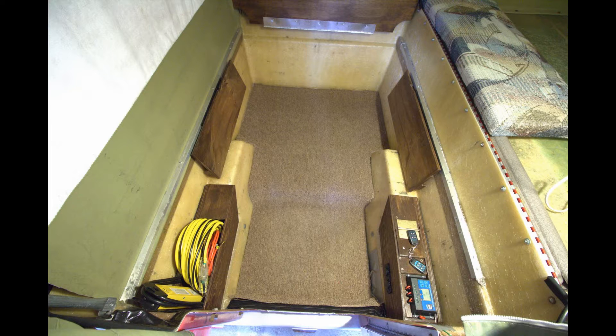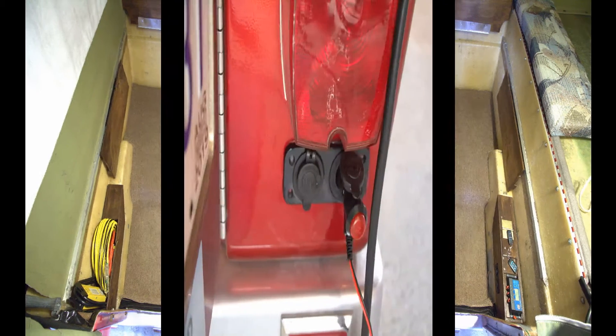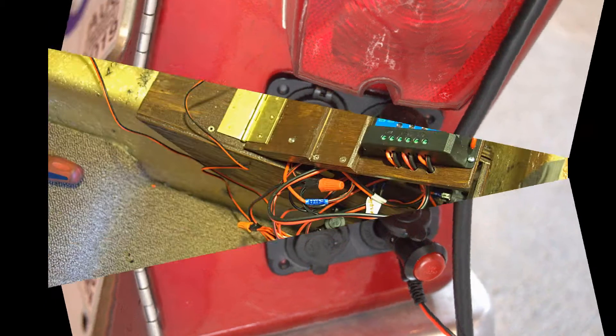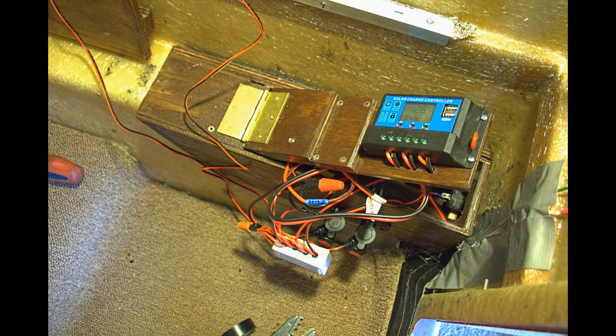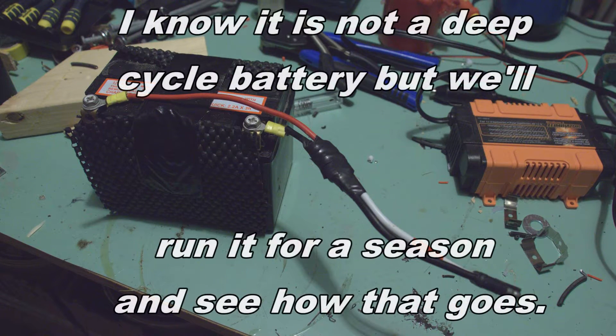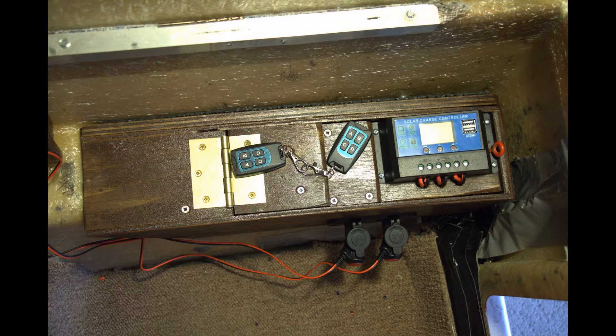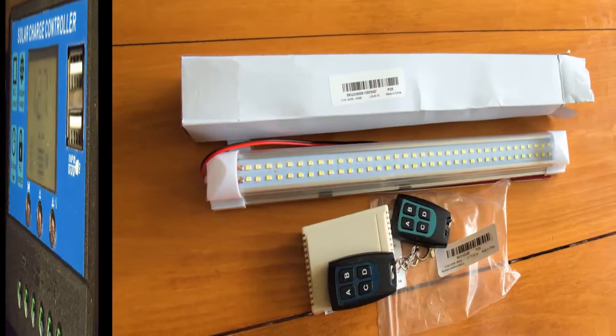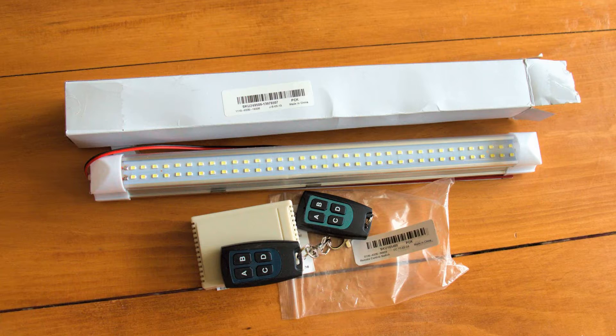I built some storage in the sides of the Minimate. I put two outlets on the outside opposite from that inlet — those are for my outside lights. Here's the kind of mess that is hidden when everything is stuffed down inside. My old bike battery fits in there, and notice I've got a disconnect on it. I discovered that the controller is constantly pulling a little draw, so if I don't disconnect it when it's in storage, I'll end up with a dead battery. The solar controller is showing 12.7 right now. These are some of the LED lights I added, and that's a remote control for turning lights on and off.